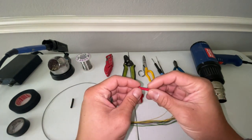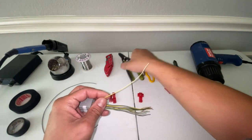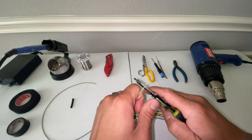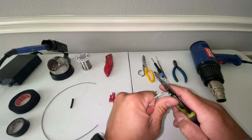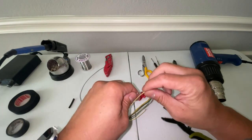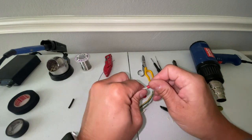So let's talk about this first splice. This is called a butt splice, and the intended use is you are actually taking the wire that you want to splice into and cutting it. So the intended purpose of this butt splice is you're going to cut this wire and then strip some of the insulation off on both ends. Then you're going to take the wire you want to splice in, strip some insulation off that, and tie these two wires together, trim off some of the excess, and insert this into your butt splice on one end.